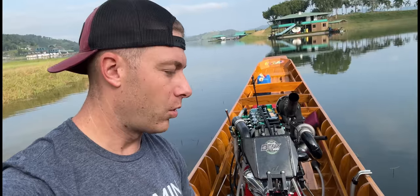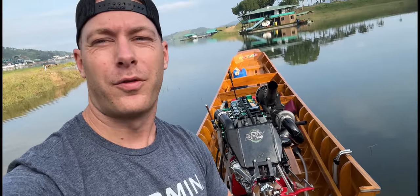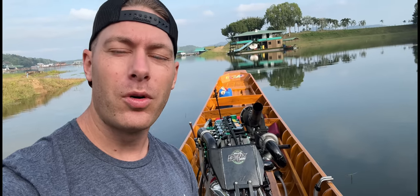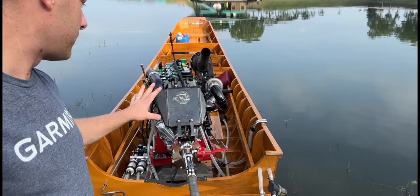So I will say that when you're holding on to that drive handle up front and on the throttle, it moves a lot. And so what I'm thinking to improve that is to build some kind of system back here that they have on motorcycles. On a motorcycle, if you're doing a wheelie, you come down, you can get what's called tank slap. And these guys put these series of gas shocks and springs. I got to look at the engineering behind it.